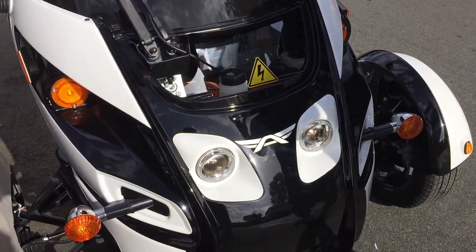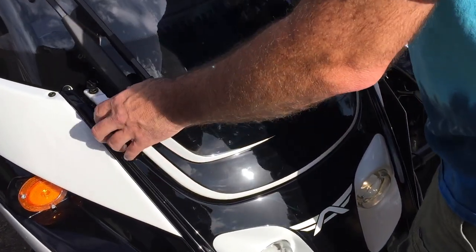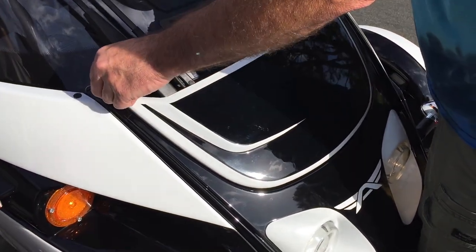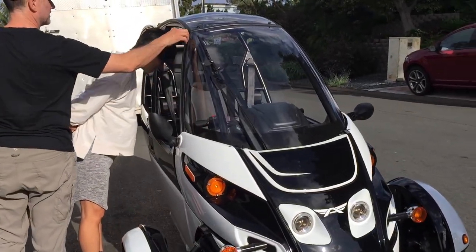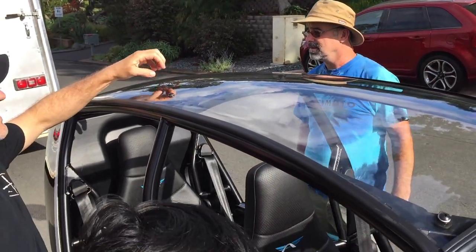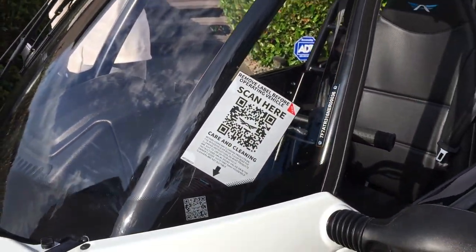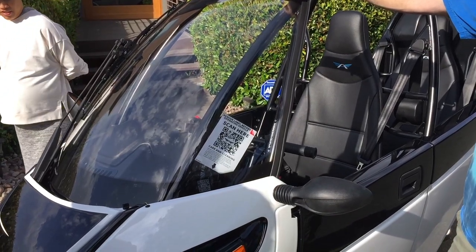This is a little bit tricky to get back on. You've got this little lip right here and it needs to fit in there just right, and these clips move around. Sometimes they line up great and sometimes they'll fight ya — just wiggle it. So this is just a rain diverter. And is this plexiglass? It's polycarbonate. One thing about that — you'll see a sticker that takes you to our website for care and cleaning. The important thing is don't use anything with ammonia in it. There's a coating on this — an anti-scratch coating — and it's kind of allergic to ammonia.